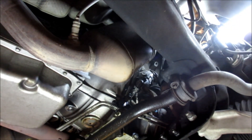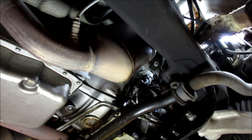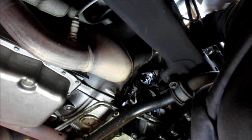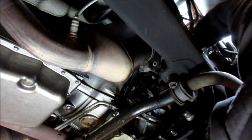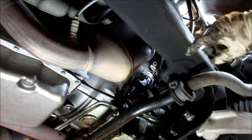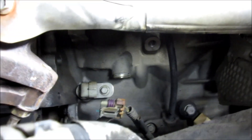This is going to be really hard to see, but I'm going to take my arm up through the fender well right over here, reach across, and go right in to where the crank sensor is. Take my finger and pop the connector off — the connector comes off real easy. You just want to take your finger right on the edge of the connector, pull the lip up a little bit, and slide it right off. Comes off really easy. Now we've got the connector off.